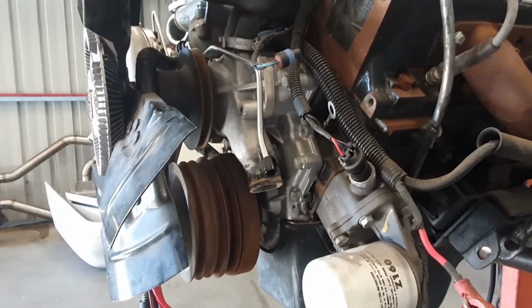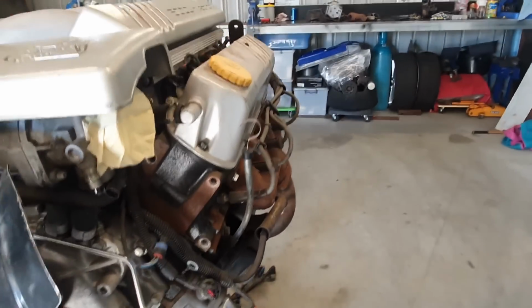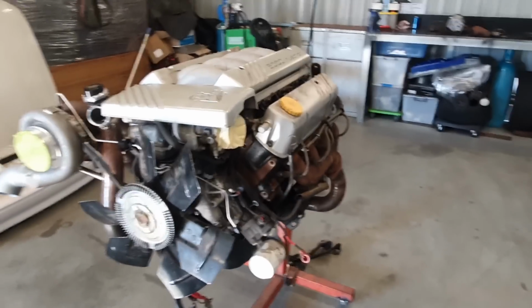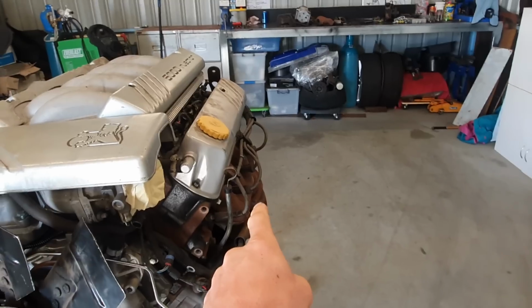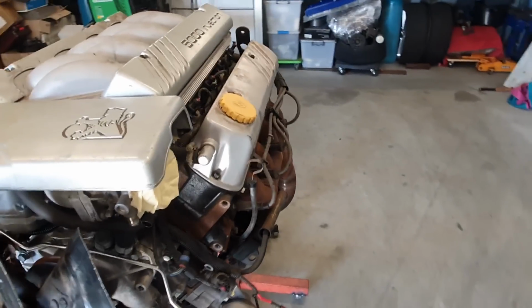and the Reid Speed 6PK alternator drive for it as well, because the alternator is usually bolted right here, but I've got it off at the moment. But for you guys, if you are looking at turbo in your car, 9 times out of 10 you will put the turbo on this side of the engine. Obviously there's no steering or anything down this way, and you'll have a lot more room.